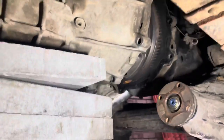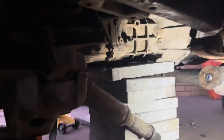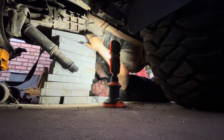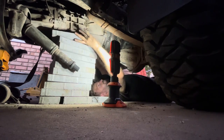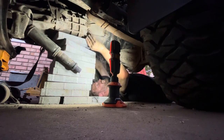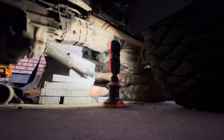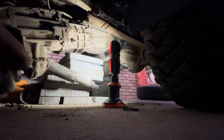Right, so it's the next day and I finally got this gearbox off — it's now sitting on those bricks. What was holding me up was actually the exhaust. I wasn't paying attention — the exhaust wraps around here and just holds it like a saddle. So I had to take the exhaust off, and once I did that, one little tug and it came off. I got those gear sticks out as well. Now I'll just get some of those bricks out, get it onto the ground and skull drag it out of here.